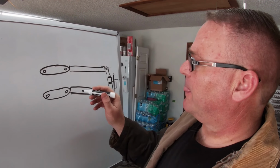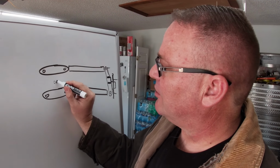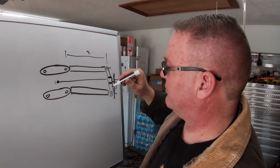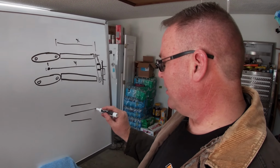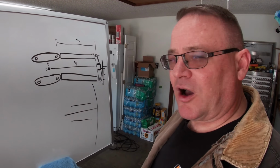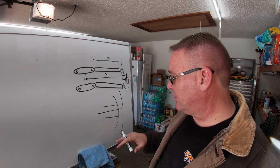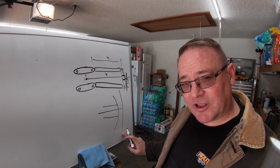So anyway, for example, if I mount my steering rack way inboard, and so my tie rod is much longer than my links, right? If this is X and this is Y, my thought is this: if my control arms are this long, but my tie rod is that long, then it makes a broader radius as it goes through the travel, much different than the one that the arms will make. If I were to jump it over dunes or what have you, it goes from full droop where the knuckle will suck in more because of the arms than the steering link.